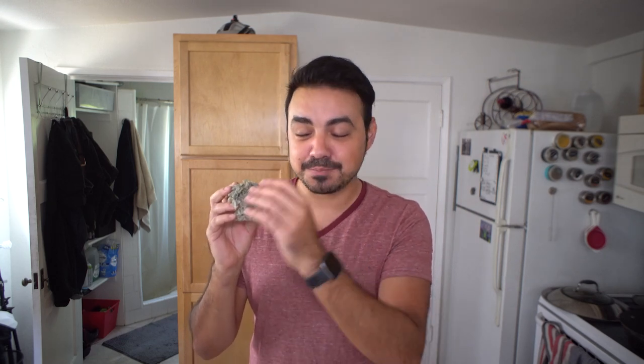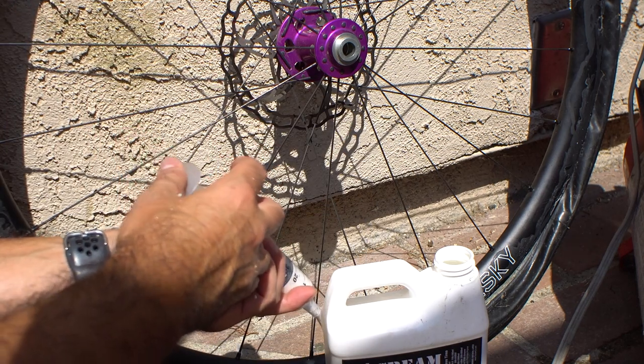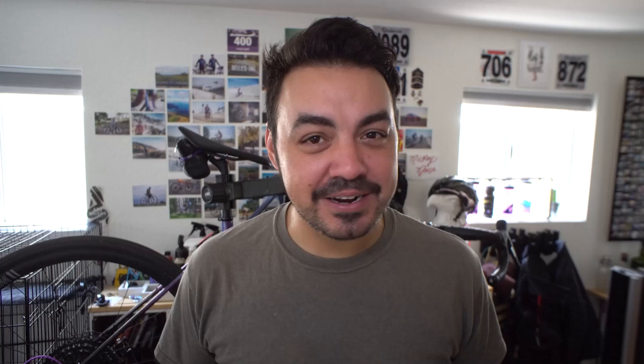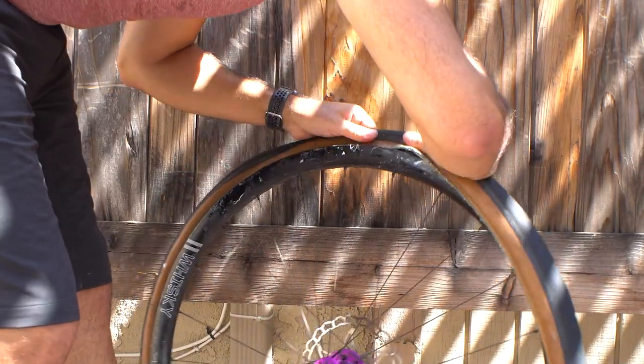I'm going to fill it up with the sealant I have — it's basically fully clean now — and see if it'll hold overnight. I'm just going to do a quick 10-minute ride around the neighborhood just to get it to fully seat and see what happens. I really want to know if this was totally the problem. Anyways, let me know if this has happened to you — if you've mixed sealants, maybe this is something I need to do: if I transfer sealants or use two different brands, I need to take the time to clean the tire out. But the second I put sealant in the tires, they instantly started weeping on the sides again, so I said nope, not dealing with this anymore. I threw the Gravel Kings on.